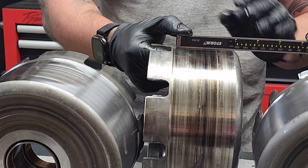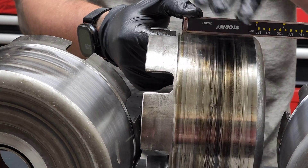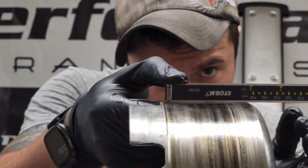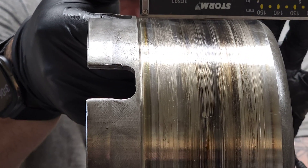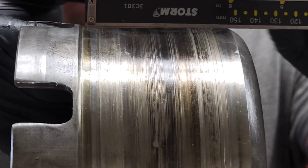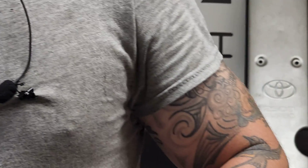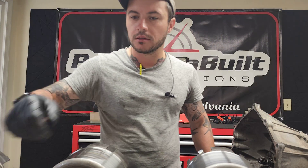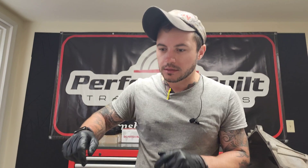Because if you take a straight edge — as you know, your band rides flat — you take a straight edge and it may be very hard to see on camera, but the middle is sunk down and the sides are up. It is not flat. That's one of the biggest failure points of the 4L60s: things are not flat, or not as they seem.